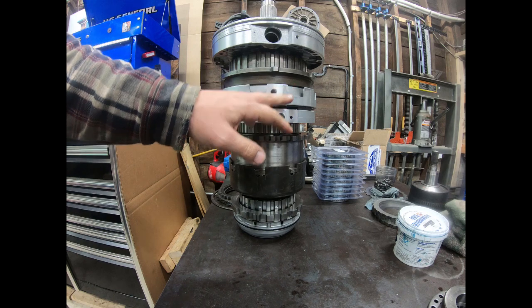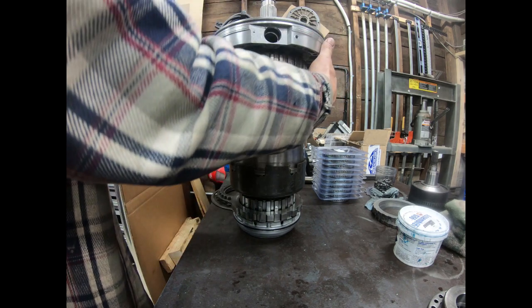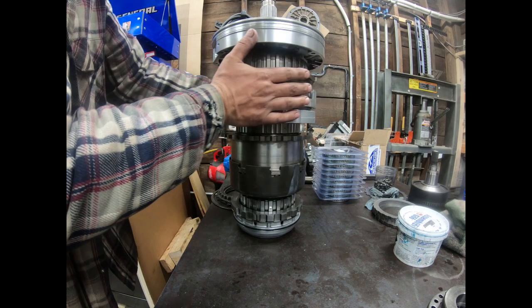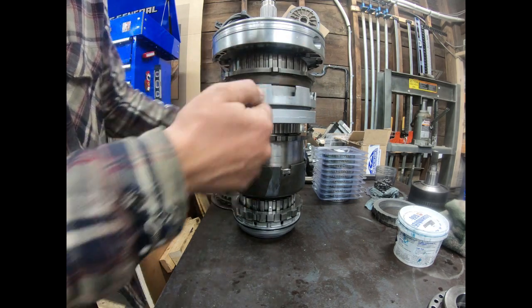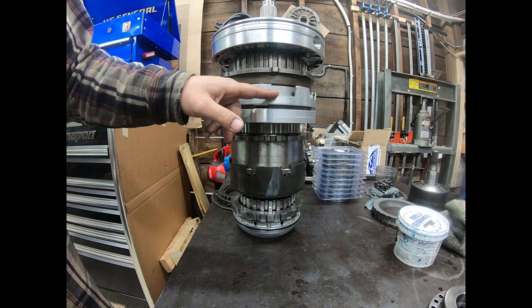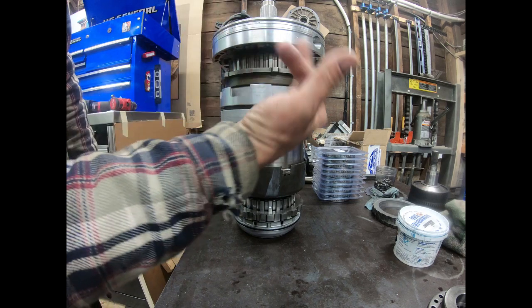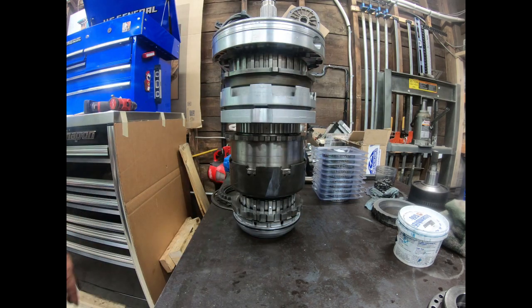These feed bolts are only on the bottom ends of these parts. If I rotate this, looking at it from the side, the center support is going to be doing that — same with the overdrive and intermediate pistons — and everything else in here is just going to be shaking and whipping around. When you're increasing horsepower coming out of the engine into the transmission, you're just increasing all these oscillations and putting more vibration in there.